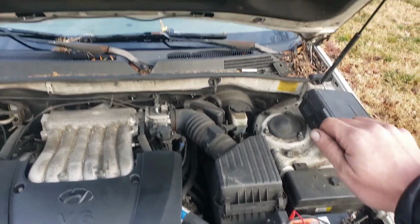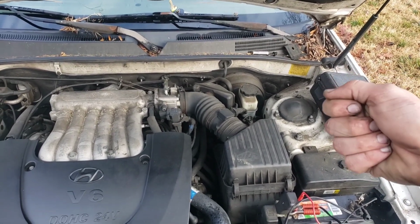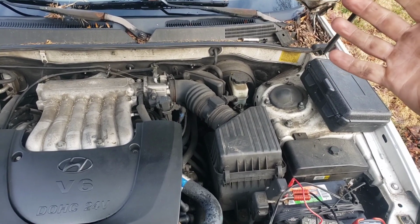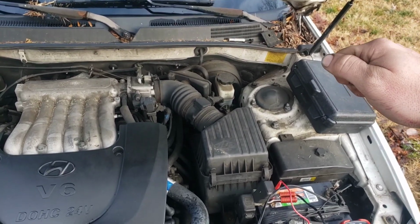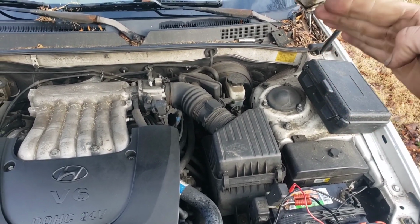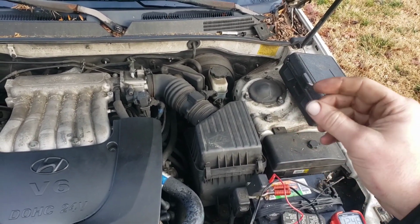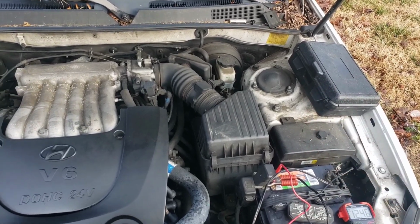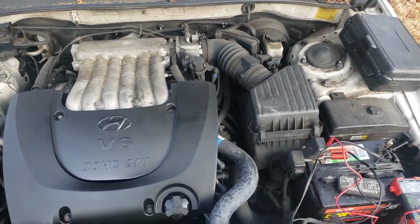Another thing, if you just sit in the car and you turn the key, and when you spin it to start it's acting like you didn't do anything, or if you're spinning through accessory and start and it's not really doing anything, or it's staying the same through some of those, you'll know, hey, this looks like a bad ignition switch, because at that point it's failing to do what it needs to do. It's not cycling through the different positions correctly. But anyways, that's just some stuff you can check for.